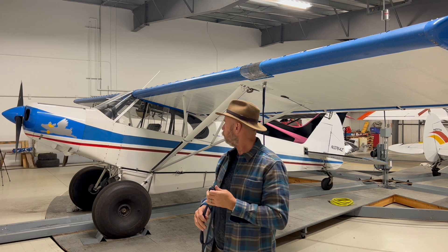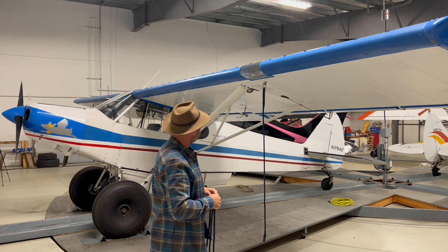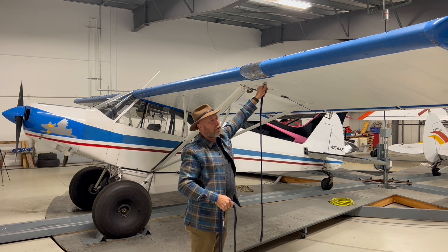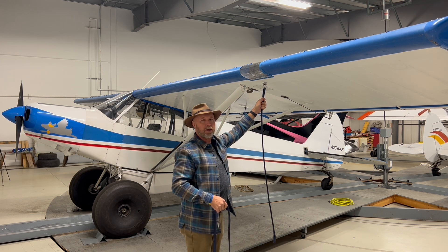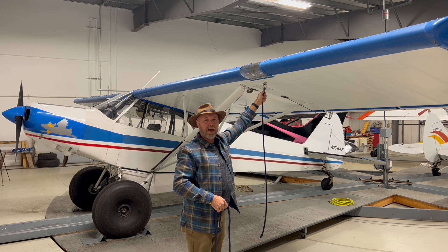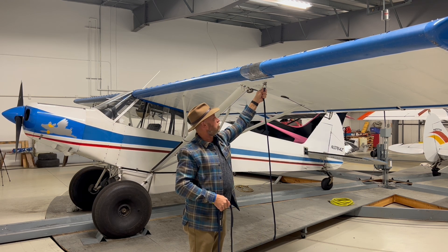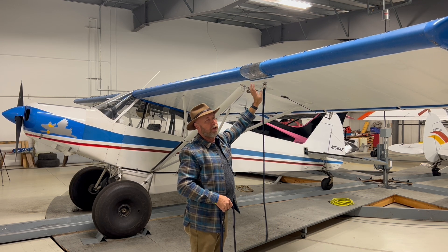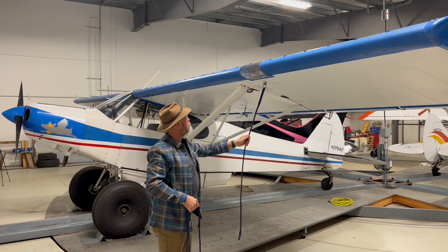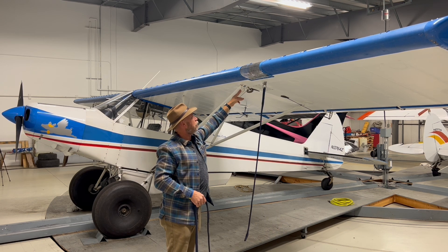Today I'm going to demonstrate first on my Super Cub, Miss Piggy, and then I'll go next door and show you on a Cessna 185 how I tie the struts. On a Super Cub you have the option to purchase these Atlee Dodge hurricane straps. This is by far the best method to tie any type of tube-and-fabric Piper airplane — Piper Cubs, Pacers, or anything along that line — because this actually goes up around the spar. So you're not going to damage it. This is a factory option, and there are some risks and hazards with using it that I'll point out on a close-up here in a moment.